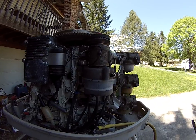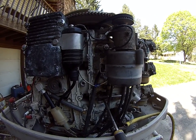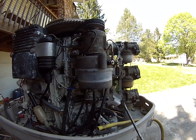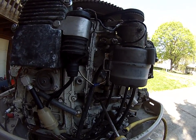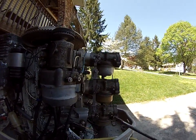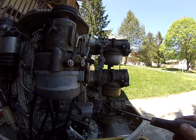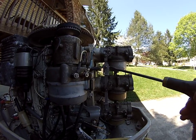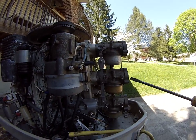The first thing we do is set up the carburetors. We pop off the ball link here at the timing tower — we pop it off at the timing tower rather than at the cam, because there is a danger of bending the cam. We move the cam back out of the way. Then we loosen this screw and this screw and let the butterflies snap shut fully, then retighten these screws. Don't tighten them too much because these clips will bend and won't hold properly — you may want to put a regular nut behind them instead of these clips.